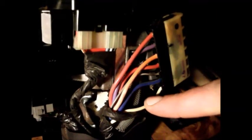But the really important thing is this yellow one at the end here. This wire is the starter wire, so it's got no power except when the key is turned right round to the start position, and then when it's in the start position these two here go dead, so that's when all your other things go down while it's starting, which is great as well. That's really important because it means I'll get better starting. If I had a starter button I wouldn't have that facility of everything else being killed. That would all still be in the on position while I'm trying to start it.